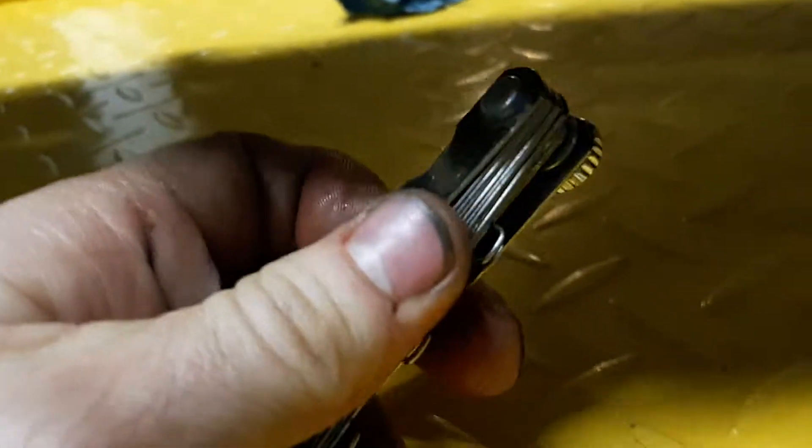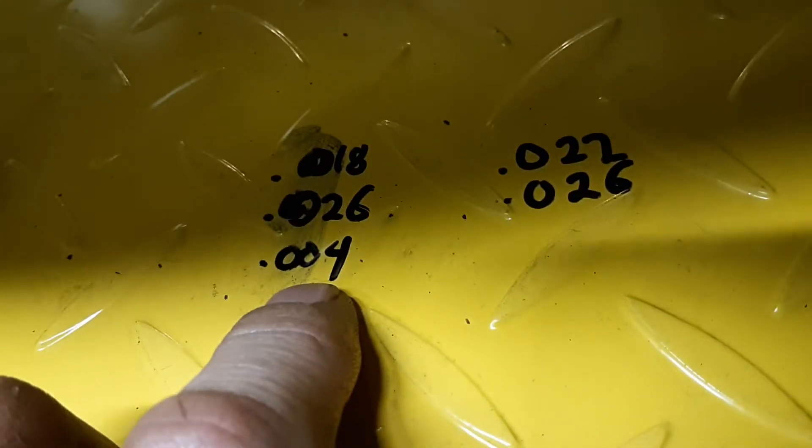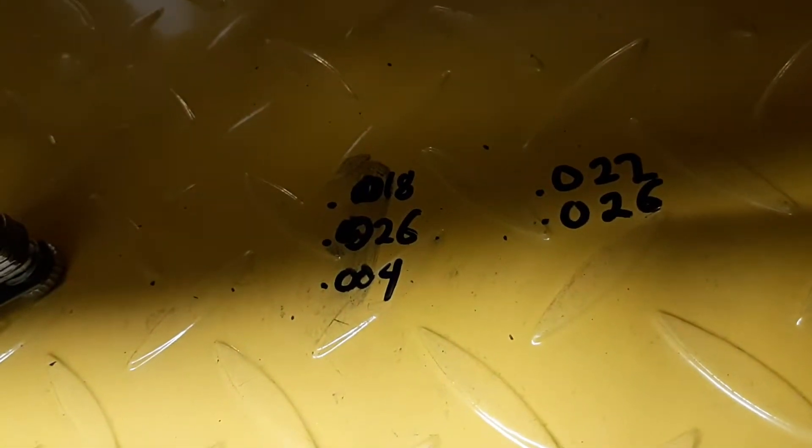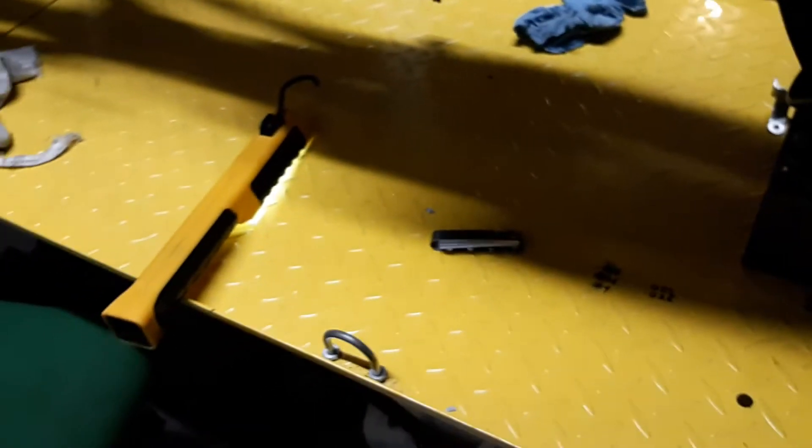There was a point on the crank at the bottom between one of the main bearing caps where you can stick a feeler gauge. I tested it using a combination of different feelers — the right-hand side pushed one way and the left the other way. The point is you can test crank end play just by pulling the oil pan off, knowing where to stick the feeler gauges, and nothing alarming in that realm.